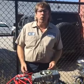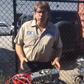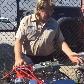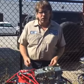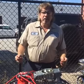Here in this Maryland weather, where the weather pattern changes all the time, tune-ups are real temperamental, but not on this engine. This engine is running 12 degrees of timing at idle. It's not overheating. It's been out here running for 45 minutes, at 190 degrees on a pretty hot day, right here in the sun. It's pretty hot on this side of the building, and it's not going to be temperamental.